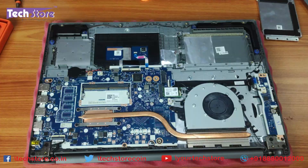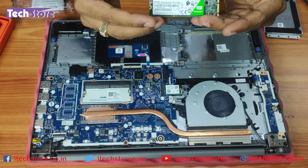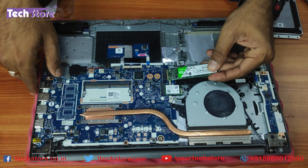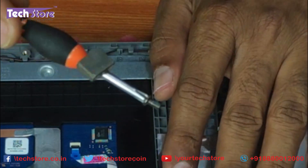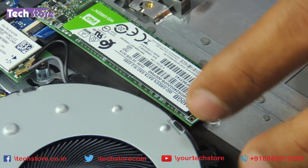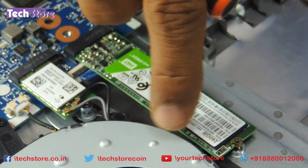For the M.2 SSD, you can buy an NVMe SSD or a standard M.2 2280 SSD. We currently have a Western Digital M.2 240GB SSD that we are putting into this laptop — it's a normal M.2 2280. Just take the SSD and insert it like this. Note that the retaining screw does not come along with the SSD. There is a slight design issue here — the SSD sits near the fan, so the SSD does not go below the fan, but we need to live with it.